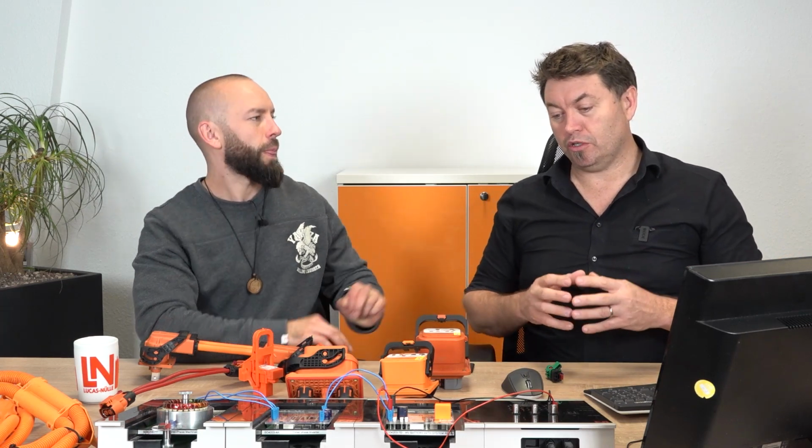Interlock. Yeah, so it's a very important component when it comes to safety within hybrid and electric vehicles. As you mentioned, it's a component that allows the controller, whatever you want to call it, there's lots of different names. So there's the ECU, the control module, the BMS, whatever the component is that is overlooking the system. This allows the computer to identify that someone has essentially tried to open a high voltage component of the vehicle, and that will immediately shut down the contactors or the relays that are transporting the high voltage throughout the vehicle.